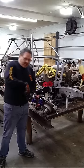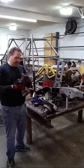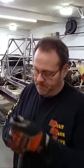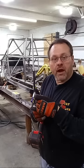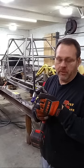Of course, I've got my tapers here. These things are not cheap either. But I got my tapers here, so you can see. That's a reamer. So that's a tapered reamer. That's what that looks like. So we've got to ream it. Be real careful with a reamer. You can only go one way. You only cut, never back up with a reamer.